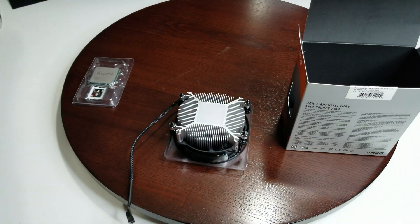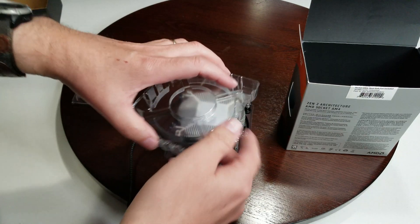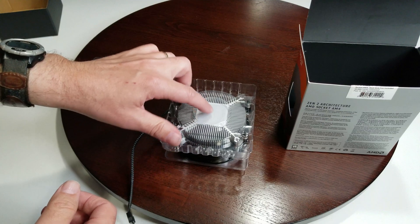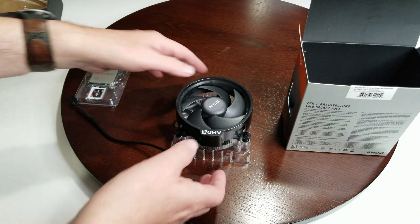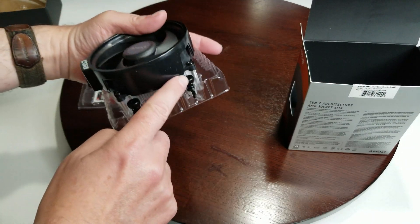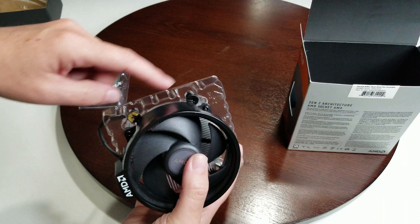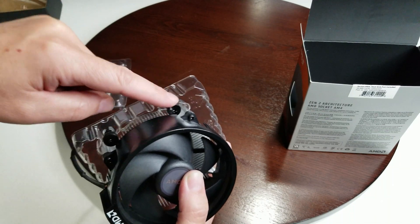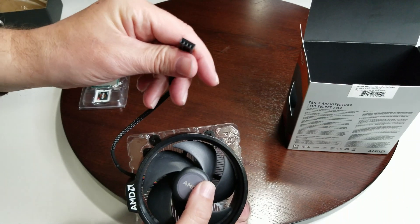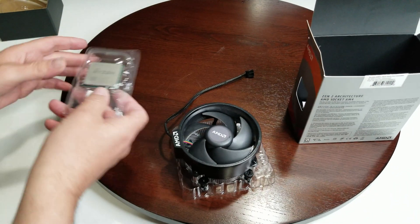The plastic came off but didn't touch the paste, so that's a good thing — plastic is on the inside of the box. Leave that covering on to protect the thermal paste. It's a very small cooler and has kind of the same mounting mechanisms as you'd find on some of the earlier Intel stock coolers. The only difference is instead of a clip where you push it down and turn it, this just screws into your standoffs on your motherboard. It's four-pin, which is PWM — not LED or anything like that.